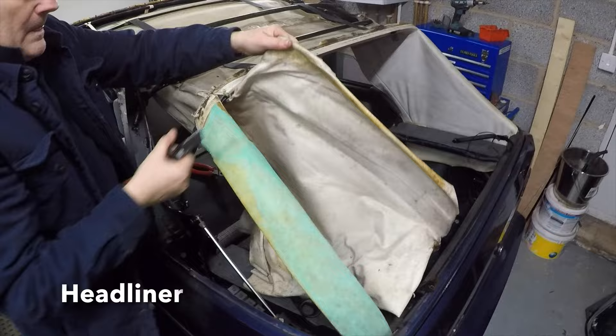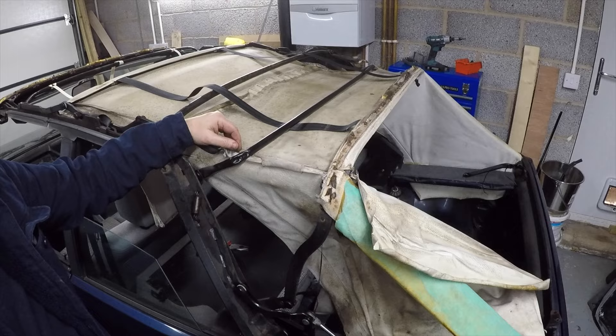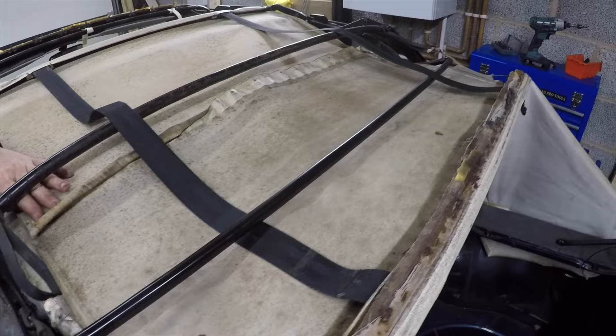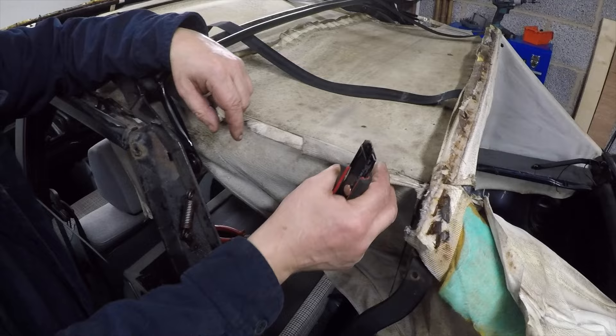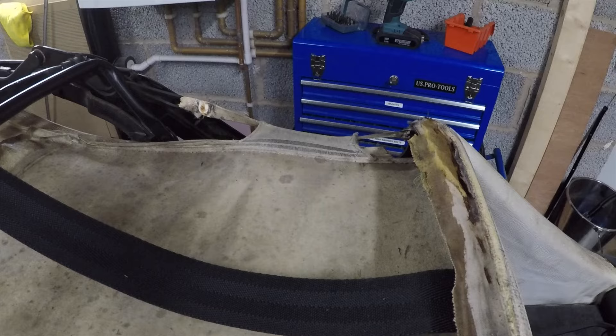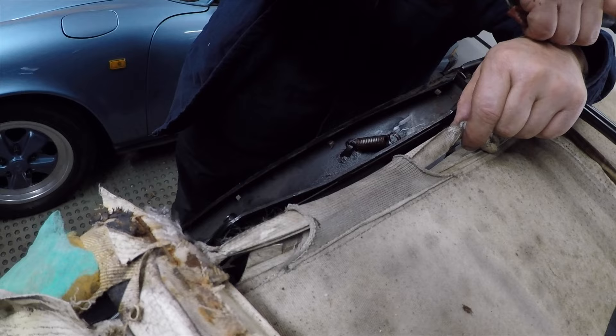Tell me about these pockets then, Carl. On headliners a lot of people say I don't want the headliner changing. As you can see the way that the hood is made up from the factory on a bare frame, the first thing fitted is your headliner. Usually what you have with these is they come unglued here - they tend to go dry - so you've got a saggy headliner, that's probably part of the reason. One of the issues we do come across is these pockets here - these are in quite good condition - but a lot of times this material rots. You can see on that one side how the material has gone quite thin and holey - there's the comparison. And that's what happens, so sometimes they fail on the corners.